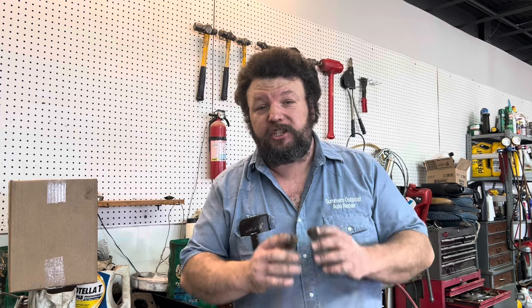The reason we're not doing quick struts on these is because they cost a little bit more, and this customer is a skinflint, a miserly little cheapskate that doesn't want to spend money on anything. It's mine — it's my car. I can eat a little bit of time to take this thing apart, and if there's a rattle or a bad mount, I know who to blame. So I'm going to pull my struts apart and change just the struts themselves.